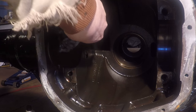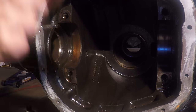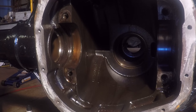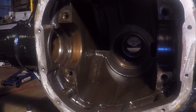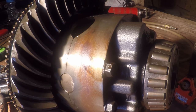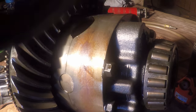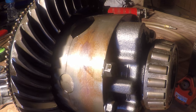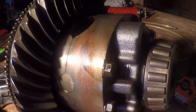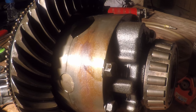The good news is the inside of the housing is pretty clean — down in this residue there's really no metal at all, not even a glimmer in there, which is good. We'll hose all this out and get it cleaned up. Over at the workbench, this is the race from what would be the driver's side. You can see how dull it is where the finish is coming off the metal. You can see the same thing on the rollers of the bearings — definitely a good thing we took this apart, because that would have been a problem.